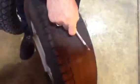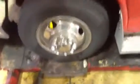This tire here is a tire that the tread is worn uneven. It's worn from the outside in, leaving no tread on the inside and more tread on the outside. If you start seeing a pattern like this, please let us know. You also need to check the tightness of your hubcaps as well. If they're coming loose, we also need to be notified of this.